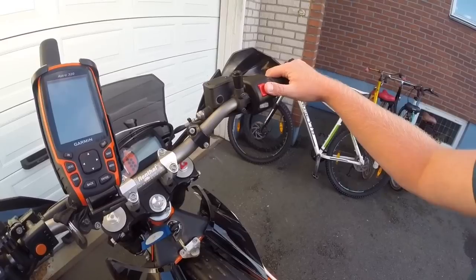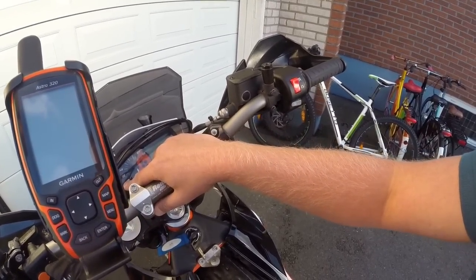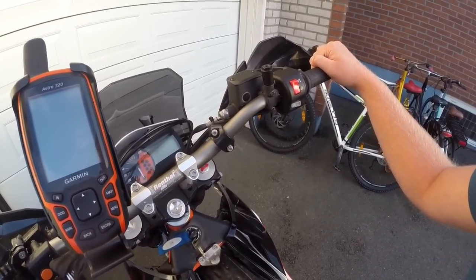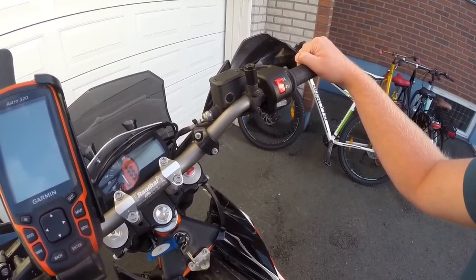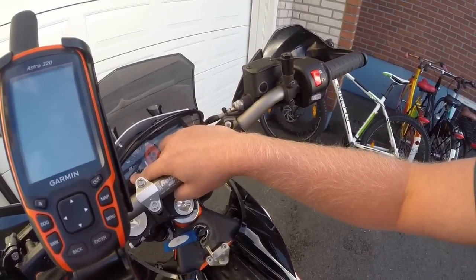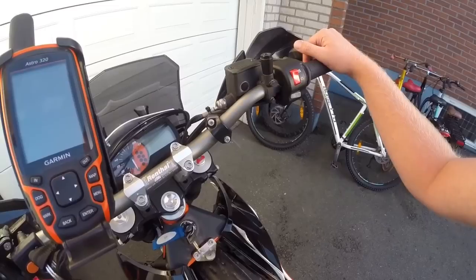That's a little bit strange actually. The only thing mentioned in the instructions is how your ABS light will flash. With full ABS on, there is no light and no flash. If you go to the off-road ABS mode — front wheel with ABS and rear wheel with no ABS — the ABS light will flash slowly. And in ABS off mode with no ABS at all, it will flash faster.